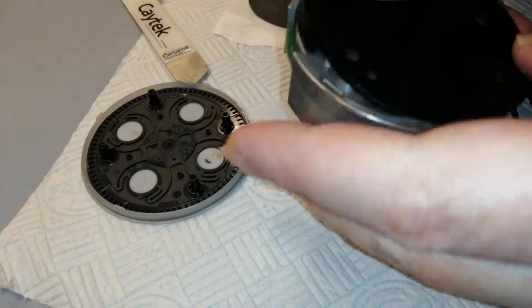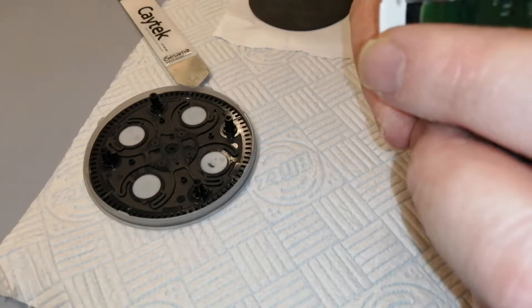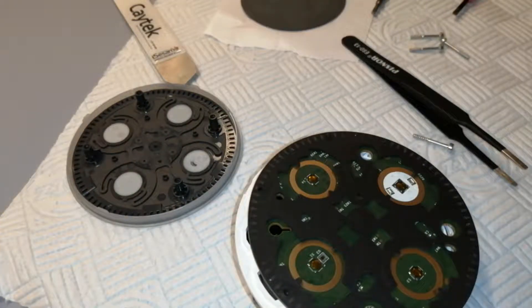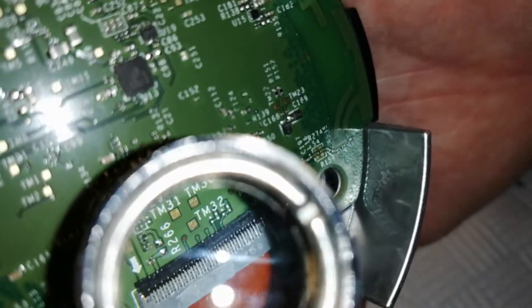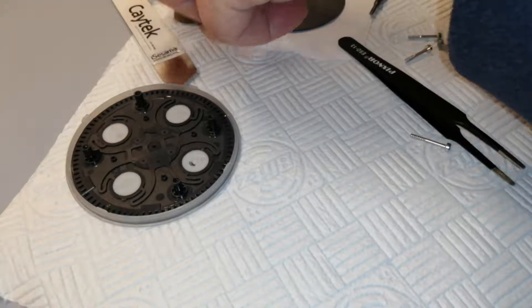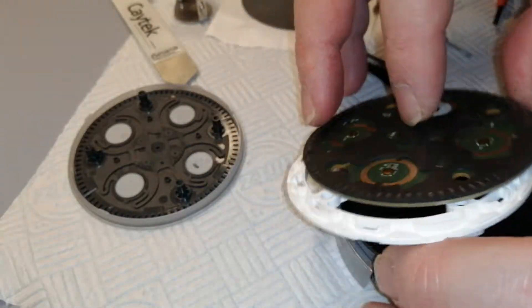How do I get this bottom board off? I'll try to work out how to get this bottom board out of the die cast housing — or is it glued in? Perhaps I don't want to do that. Under the magnifier you can see that the connector housing is fractured — the middle part has broken off. I don't want to try and lift that one up too much more, because the ribbon cable is held captive in there, and if I pull it I may not get it back in again. I don't think it's worth the hassle.